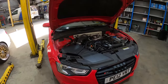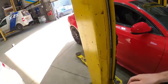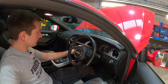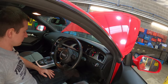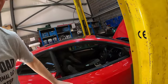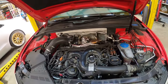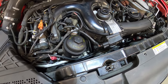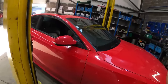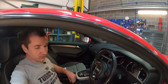Andy's finally managed to get the A5 sorted. It's all back together. I'll fire it up, leave the bonnet open so you might be able to hear how quiet it is now. It's working! No knocking, no banging - all good. Put a new tensioner on there and that idler pulley on there as well because that was getting a bit noisy. So we'll go for a little drive and see what's what.